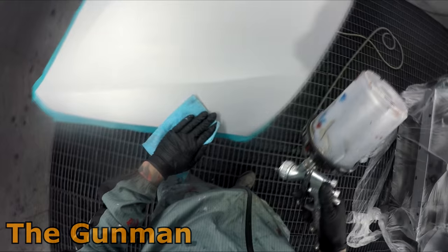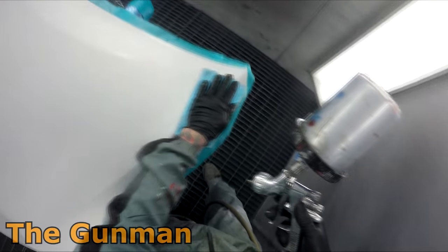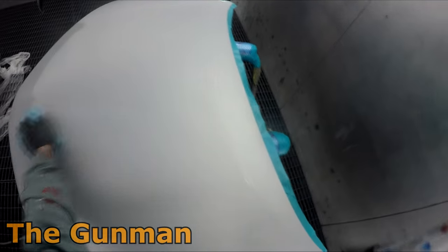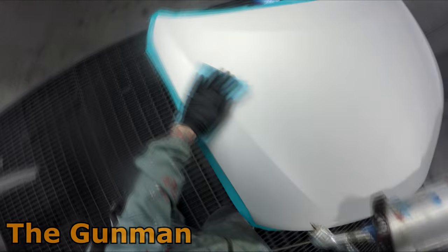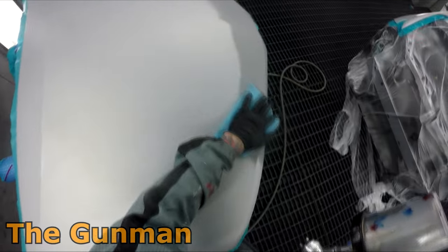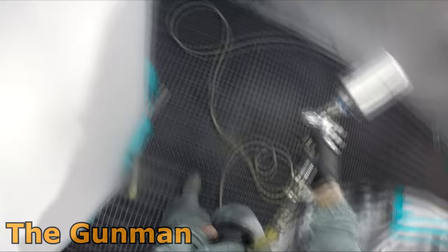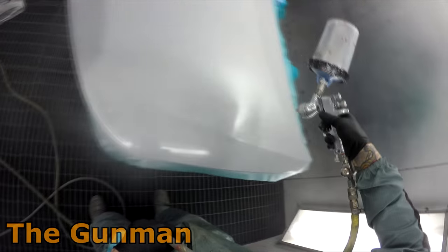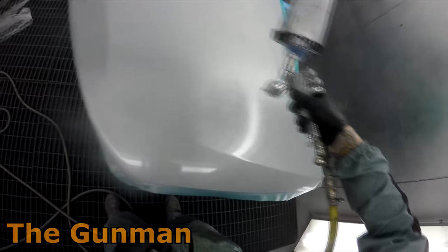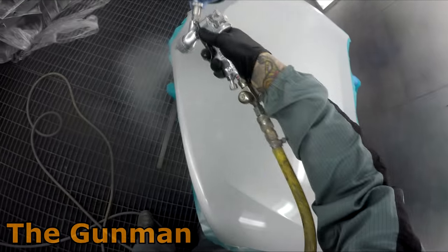All in all, I'm very impressed with this system — it's definitely great. A little bit longer drying times, but you can work around that by turning the booth heat up. I try not to blow air on it because I've done it a couple of times with an air blower gun and ended up with silicon all over it. Even though we have wall filters and receiver dryers, when you're blowing air onto the panel you're amplifying the amount of contaminants — even if it's 0.1 of a gram per 100 grams, you're blowing so much air on there.